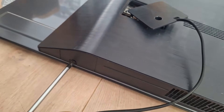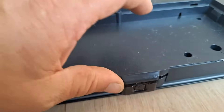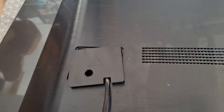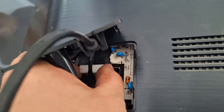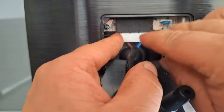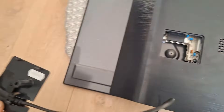There's still a cable sticking out at the top which we need to disconnect. You can already see we can lift the casing a bit at the bottom near the power button. To remove the cable on the left side, fold it away to the side — you can see it's connected with a plug. Use both hands to disconnect it: there are clips on the right and left that you need to squeeze together. Wiggle it a bit and then the part will come out and the cable is disconnected.